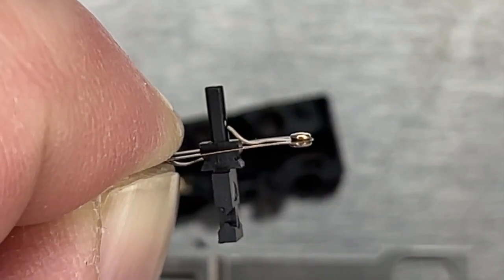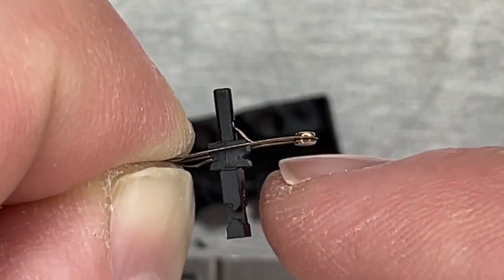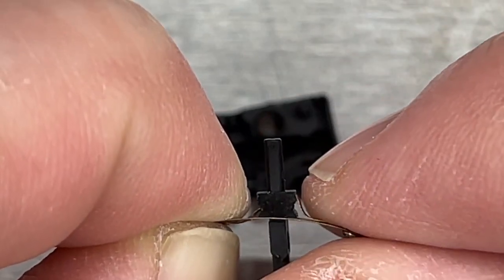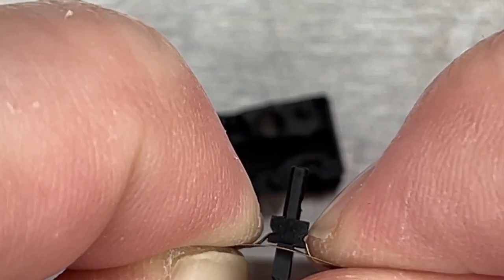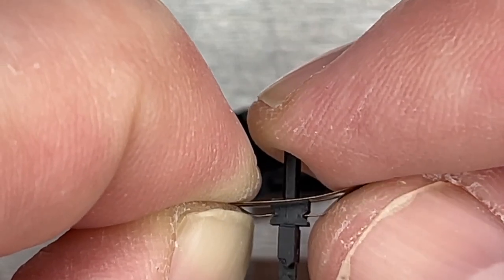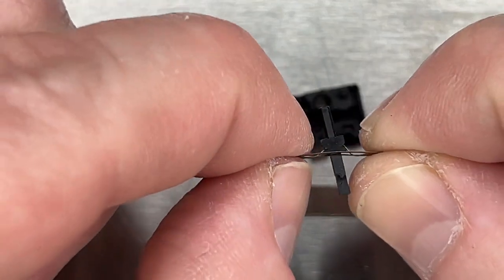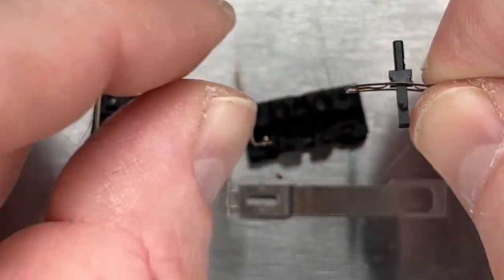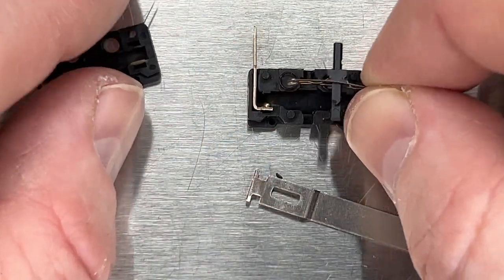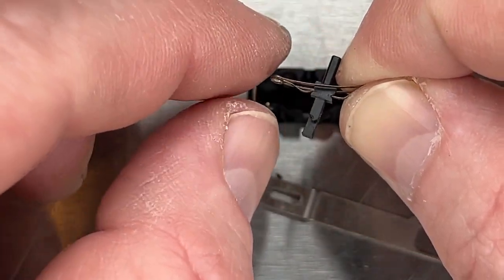So if you remove this piece and you don't see that both tabs on the metal piece fit into the grooves at the center of the plastic rod, just ever so gently position it back into place. Then you'll have a spring-loaded action and that audible click sound. Once you've sorted that out you should have been successful in repairing your switch.